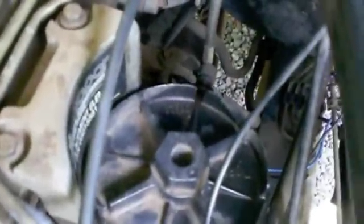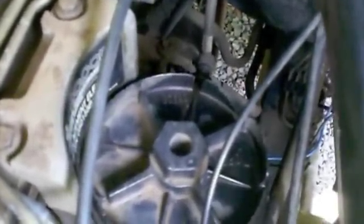This is the fuel filter housing — this is the area where it is, where you find it. We need to open that top, remove the filter, replace it with a new one, put it back, let the system air out, and start the truck and use it again with a new filter.